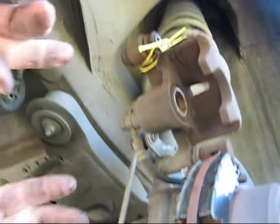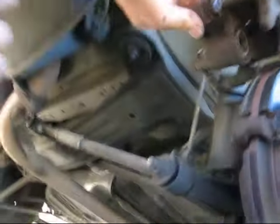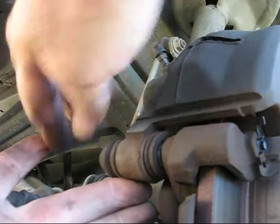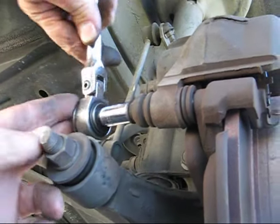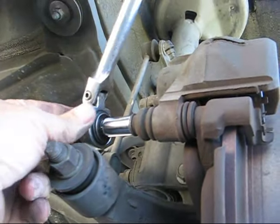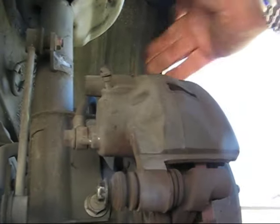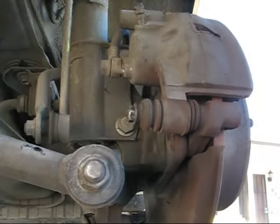We tied off the top here just to keep it out of the way. Now we'll just gently pull this all the way down. Can't get it to fit — just give it a little push and there it comes. Push it right back in place. Take the bolt and attach it with a ratchet — this is a 12 millimeter. To tighten it, we go clockwise. And that's it. The two pads on either side, we just lifted the caliper out of the way to make it real easy.